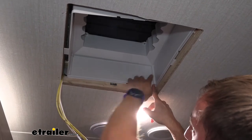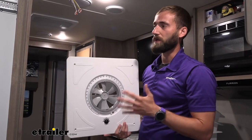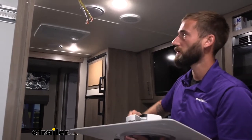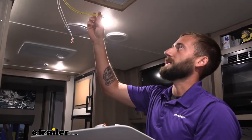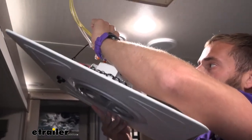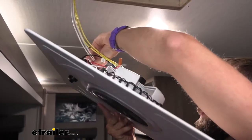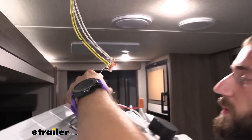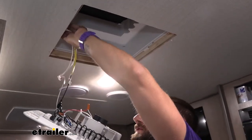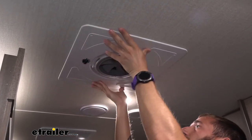On each one of these corners we're going to need these to line up with the holes on the top of our roof, and then line up with our actual vent itself. It doesn't really matter which way you place it along here when mounting — just whatever you feel looks best. Now we'll go ahead and hook up our wires. We have a real easy connection point: all we have to do is slide our wires in and press down these little tabs. My yellow is my power so I'll pop that in place and clip it down, and my white is my ground. Normally we would have to butt connector these together.